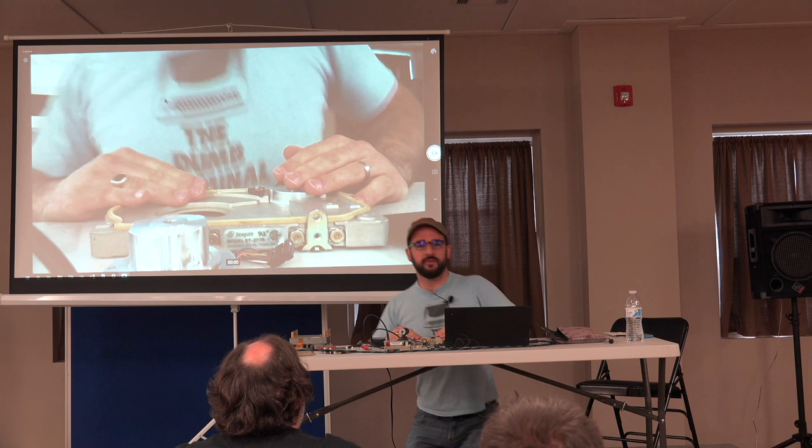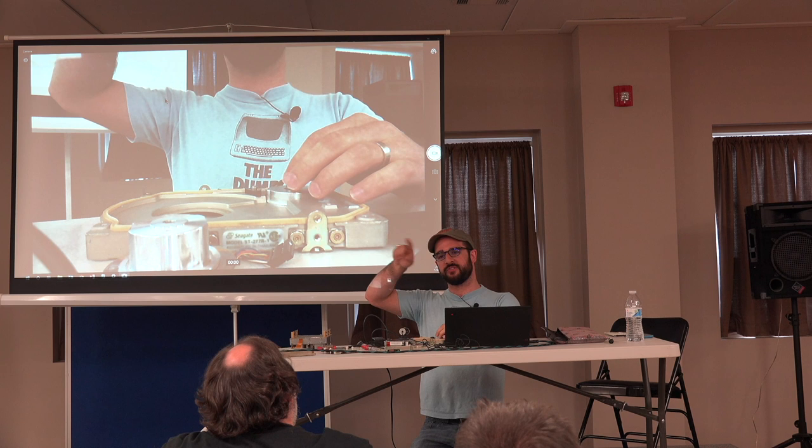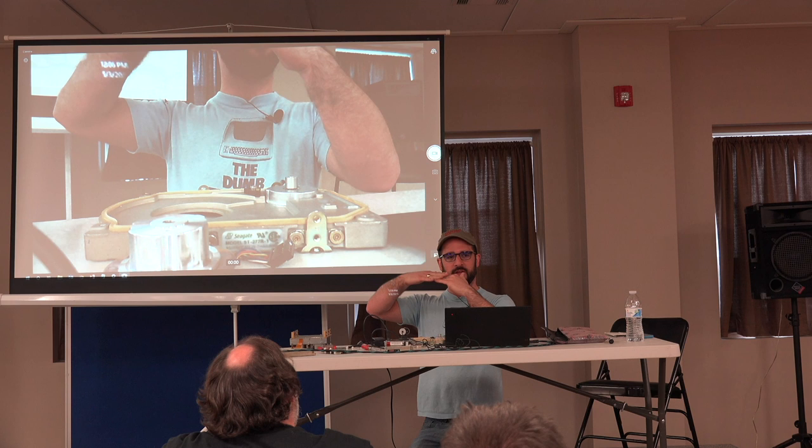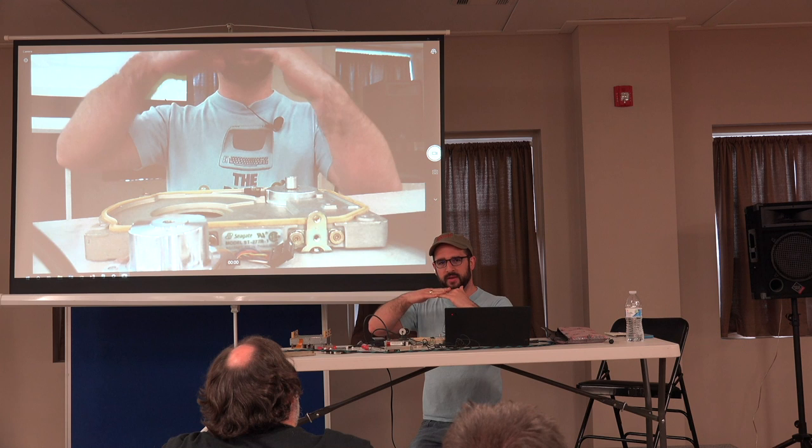So you might have heard of head parking, and what you do is on the disk there's a cylinder that has no data on it. So whenever the drive gets turned off, it moves the heads to this parking cylinder. The drive spins down, it coasts down, and the heads just touch the disk, and that's okay. And then when this turns back on, they'll touch for a little bit, then it comes up, they lift off.